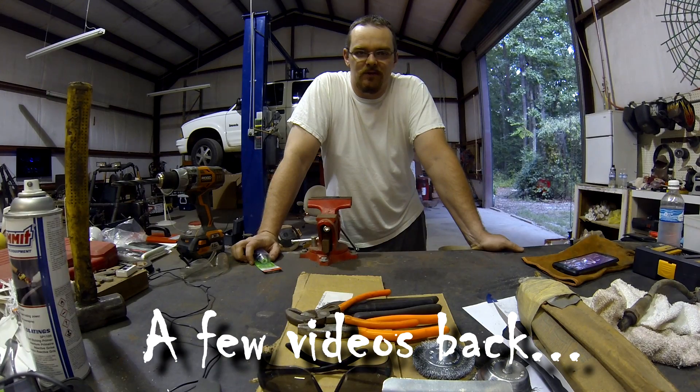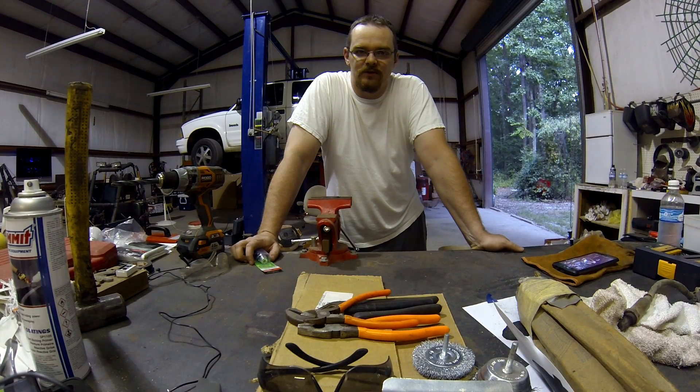Hey there YouTubers, if you watched my last video, I've been battling with emissions on my vehicles. The one behind me up on the lift is no different. If you look at my OBD scan tool video, you'll see that I was getting a P0420 code. With the scanner, I've determined pretty much I need to replace the catalytic converter. However, my wife found some information on YouTube, and I'll link videos in the description to the original two videos that I watched.